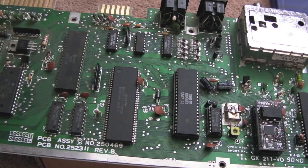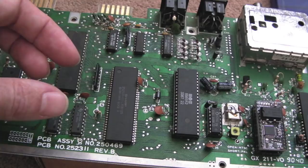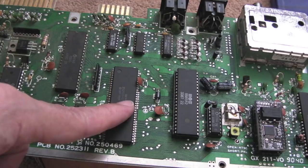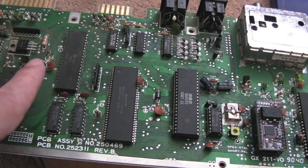I have seen weird behaviour like that before. In fact, if you cast your mind back to my colour RAM repair video, it was actually reported as a PLA fault at the point where it came to test. So it's no surprise we're getting similar sort of behaviour. It's going on about one of the 4066s and it's saying the DRAM is at fault. So there could be more than just the colour RAM fault inside here. The 4066 is used internally to switch on alternate cycles so that the VIC can access the RAM on alternate cycles from the CPU - there could be something going on there.